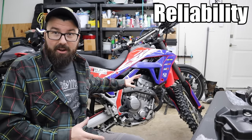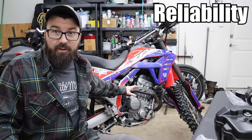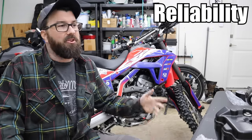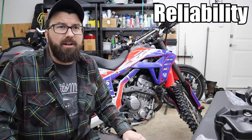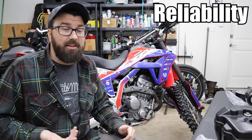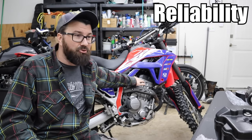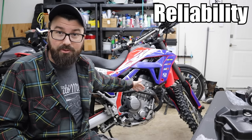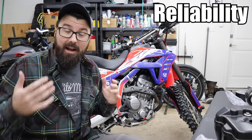Now let's talk about reliability. One of the big things that makes this bike so cool is that it's cheap and very reliable. The modifications we've done — all the bolt-on stuff on the outside that just allows the engine to breathe better, coupled with the custom tuning — should not affect reliability. Some might argue that more power means less reliable, but you could also argue that when it breathes better, especially through the exhaust side with proper tuning, engines tend to run a little cooler. We went into the engine when we put the CBR cams in, but all the components in the head were exactly the same as the CBR, so those cams were a direct drop-in. Technically we may have a little quicker valve train wear, but we're within factory reliability. We've done a good job of increasing power, and we're basically still factory reliable.